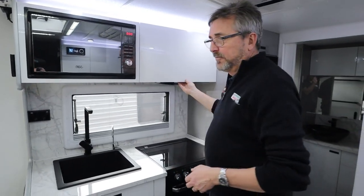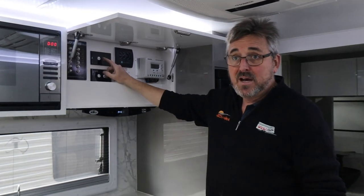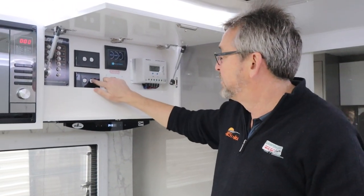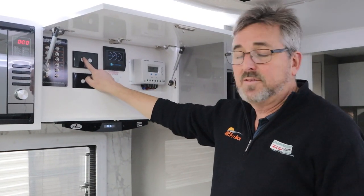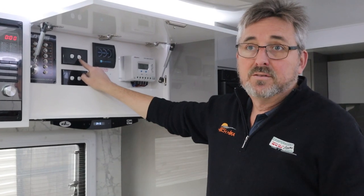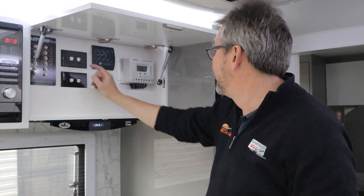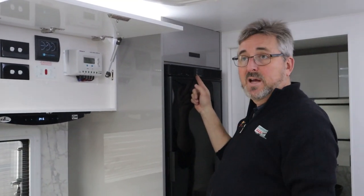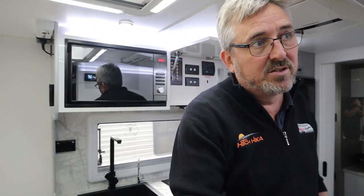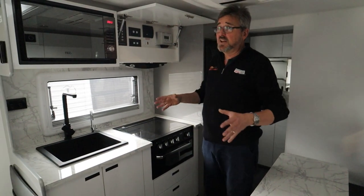If we're packing up for normal travel, you would come back into your cupboard to get your keys. You'll turn off your air conditioner, turn off your hot water service, turn off your pump. For normal travel you'll leave the fridge on - but I'm turning your fridge off for this transport. The little blue light's gone, so that's a good indicator. Then you turn the white one off and all your 12-volt power turns off. That's how you want to travel.